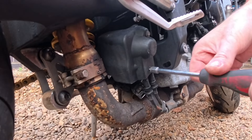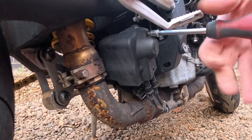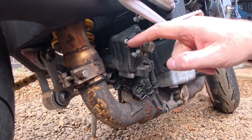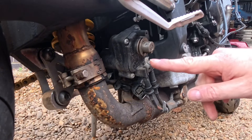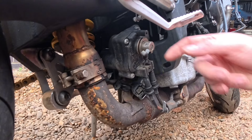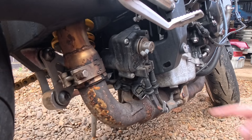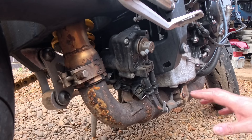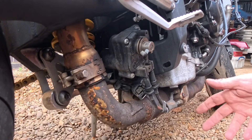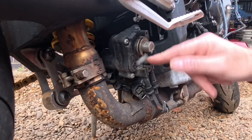So although we're not too concerned with my servo motor because we are going to get rid of it, I just wanted to have a look. And there we go — first I've seen of this — somebody's put some electrical tape around the cables and they've disconnected it. The reason they've probably done that is to keep the valve open all the time. When the valve is in its resting position, it's open — full diameter of the downpipe. So when the cables are disconnected, this is the cheapest way of doing it.